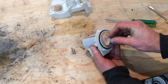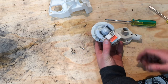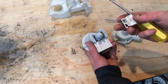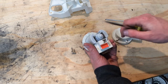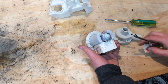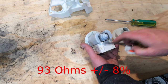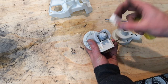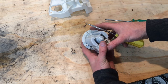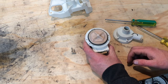If you have a lot of side-to-side play — this one hasn't got any — but if you have a lot of side-to-side play, that's the pump motor wearing internally and you're going to need a new pump. As I mentioned, there's a little thermal fuse built into these pumps to help them if they're overheating. If you're not getting 91 ohms across there — it's usually 90 ohms, plus or minus 10% — usually they're open circuit if they've failed. You can't get this as a spare part; the new pumps have a slightly different layout but use the same plug and fit in the same space.